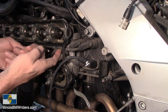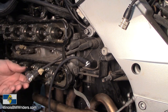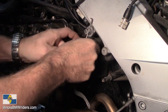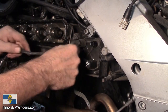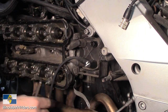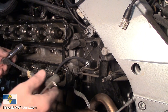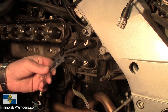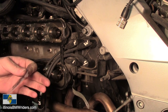Okay, next one we'll go with is number three. Once I get them all hooked back in the correct way I'll show the routing as how it goes in. I'm just going to go through here - four, three, two, one - and you'll get the idea. I've got them all marked. Now I'm going to put a little bit of this dielectric grease on here - I'm just going to apply the dielectric grease to just the inside lip.